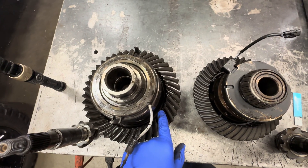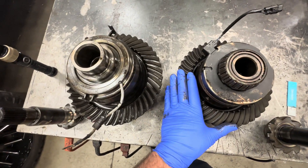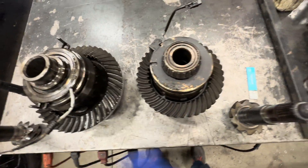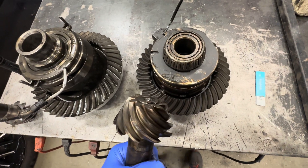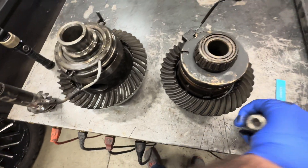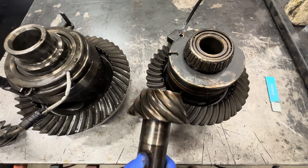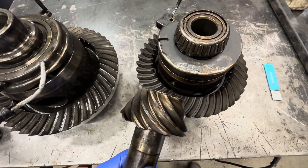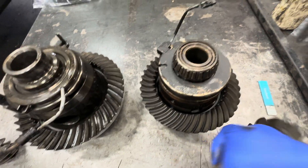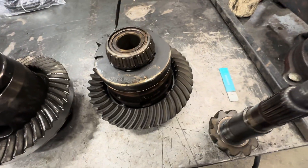I think one of these is 10 inches or something like that, and the Dana 44 is under a nine-inch ring gear. So the Dana 44 would be weaker, the Dana 60 stronger. As you go down in gear size, it doesn't matter if it's a 60 or 44 — the ring gear gets weaker. If you stay up on the gear size, bigger, the eight-speed helps that because we've got a lower first gear now at 4.71 to one. So we don't need to go with such a low gear, we can go with a higher gear. Makes it stronger.